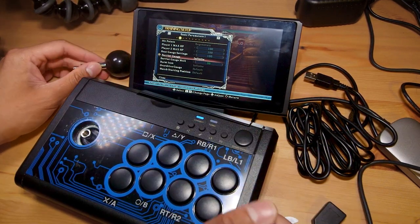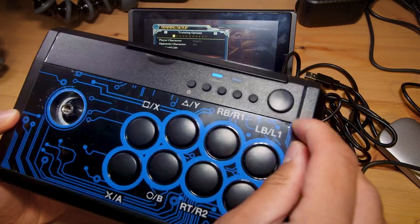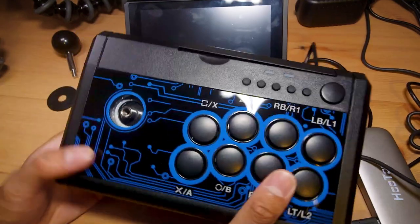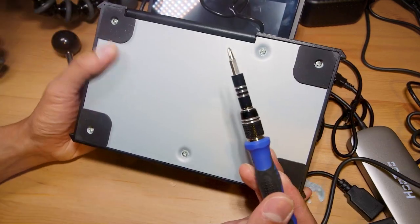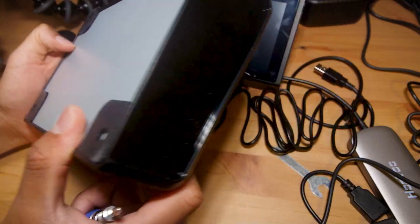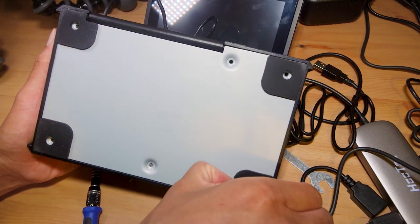That said, let's have a quick look inside the stick itself. I noticed something was getting a bit messed up — there is a plastic film so let's peel that off. Let's unplug from the Switch first. It does have a plastic film protecting this artwork — it's just a weird PCB trace design. Seeing as I've removed the joystick I don't need to protect it with my dumbbell method, so let's just unscrew it. This is my Philips 1 screwdriver. There are rubber feet on the bottom and a total of six screws.